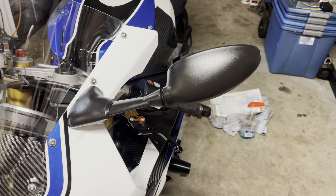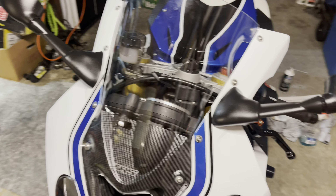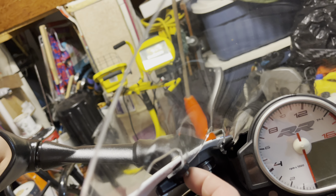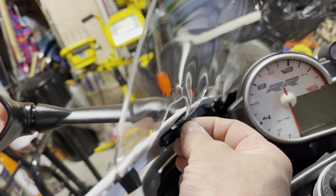Welcome back, our oil kit came in. We have our new oil filter, which is the BMW one, we have our crush washer, and we have our four quarts of oil. We're first going to pour a little bit of oil into here and then coat the seal with oil very well so that it doesn't end up sticking to the block.